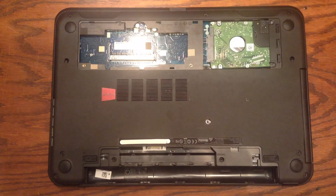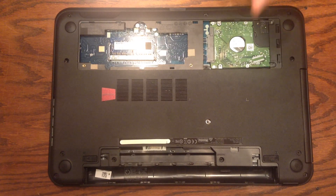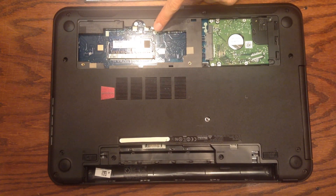What we're interested in now is the RAM, which is this little piece right here. You'll notice there's only one socket — some machines have multiple sockets, but this one only has one. So when you upgrade to 8GB you've got to make sure your 8GB upgrade is only a single chip, because some 8GB upgrades come as two 4GB chips and that won't work here. I'll put a link below the video to a RAM module that's known to work with this machine.